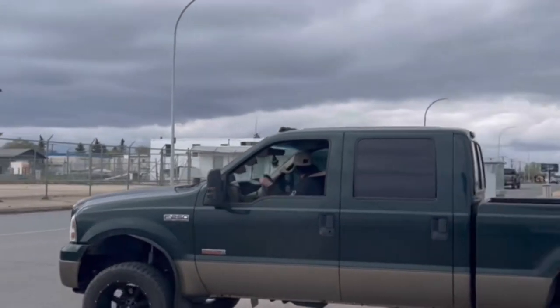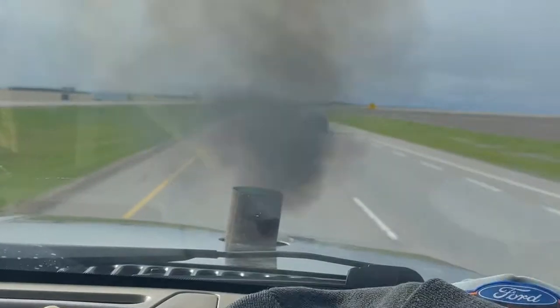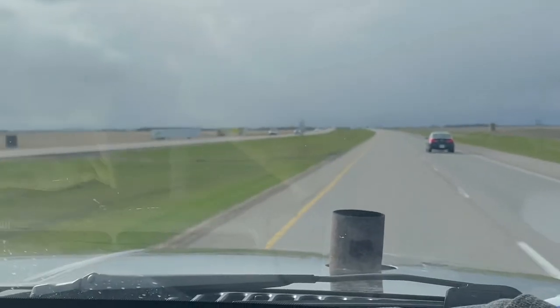As I'm currently sitting in my bed editing this video, I forgot to mention - we tested the hood stack out, worked pretty good, pretty mint. But when we were doing this we must not have tightened an intercooler boot clamp very tight. I blew a boot off on the highway - I was fully floored in fourth gear, dropped overdrive, and all that pressure just blew that boot off. We actually got it on video, so I'm gonna post the videos after this of testing out the hood stack, and there'll also be the boot blowing off. I'm kind of happy we got it on video.